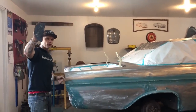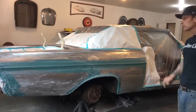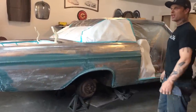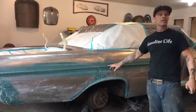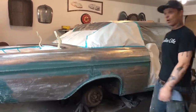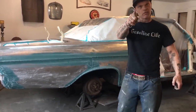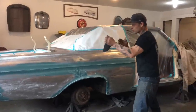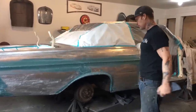Fiberglass is on. I took a piece of 36 grit and just rubbed off the heads of the fiberglass — that's it. I'm going to fill this now from here to there. I will know when I sand through the body filler when I hit fiberglass that I'm getting close to metal. When I hit the fiberglass, I know after that I've got metal. When I sand this quarter panel out, I will not stop until I hit metal, but once I hit metal I will stop. You cannot go any further than metal.